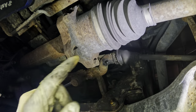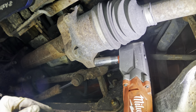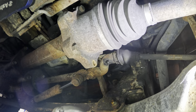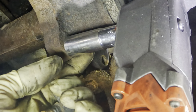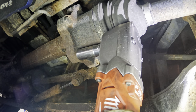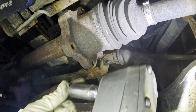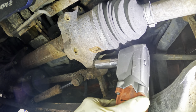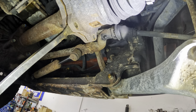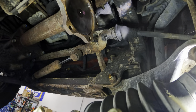Okay, this is the right front CV axle. This is part of the differential assembly, so I'm going to go ahead and pull these bolts out. We're going to separate the CV axle from the differential. Almost got my finger. Good thing I know how to move through the matrix. Let's get these guys separated while we're here. Just pry them apart - a little bit of down action. Axle's done. And we'll go do the same over here on the driver's side.